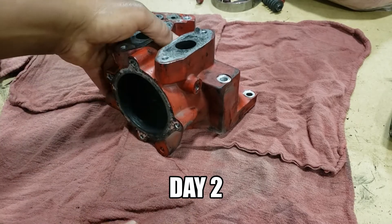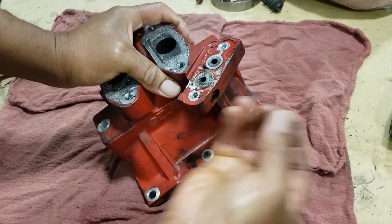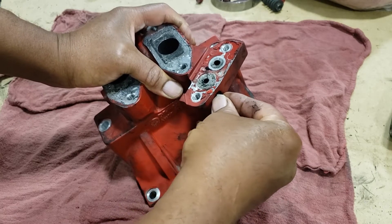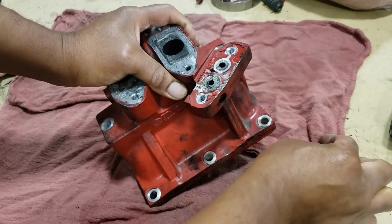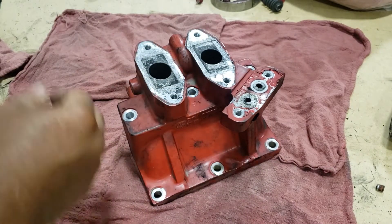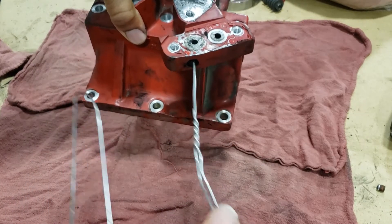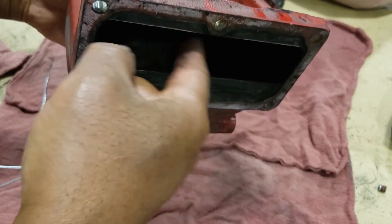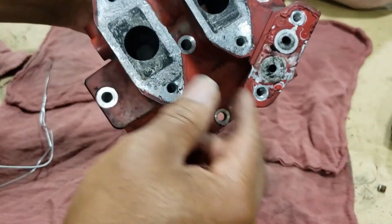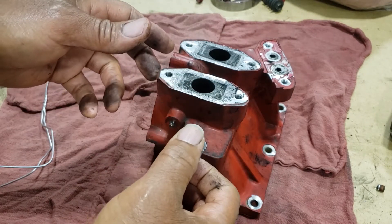It's the next day. I let the intake soak and there's a plug that goes here — I went ahead and screwed it out; it has an allen head. I took a wire hanger and made sure it was clean. You want to make sure all of your ports are clean. I took the liberty to scrape the inside walls of the intake and get out all the carbon as much as possible, then blew it out — that's a good thing to do.